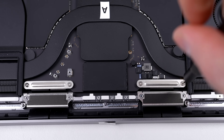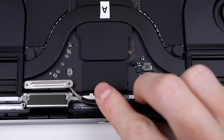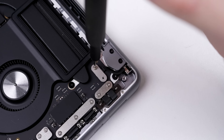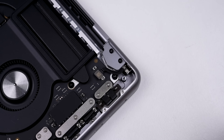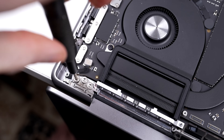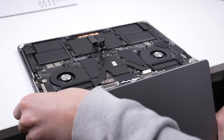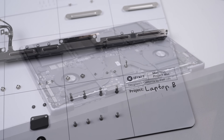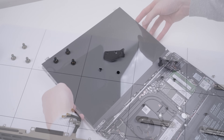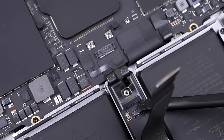Once removed, we can start detaching the display's flex cables, which are housed under metal brackets. There is a third cable to the side of one of the hinges that is responsible for reporting the angle of the display — as we're about to find out, this cable is more important than you might first think. Under two decorative covers are the main hinge screws. To remove the display, we must hang it over the edge of a table to allow the screen to clear the top case. It took a total of 45 screws to remove the display. In comparison, the Framework laptop I looked at recently required only 9 to remove the bare LCD panel.